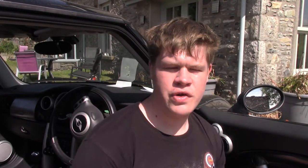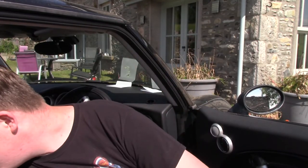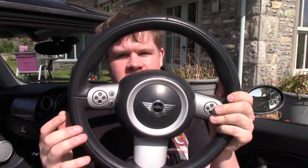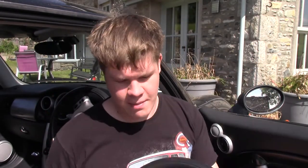At the moment we've got this horrible looking two-spoke steering wheel just behind me. It is the multi-function steering wheel, which means if you've got cruise control or heated seats you can adjust that on the steering wheel. So if you're doing the swap yourself, make sure you check that before you order your new steering wheel. I also have the new steering wheel we're going to be putting on, which is the much more preferable three-spoke Cooper S steering wheel, and as you can see it has the buttons on the front — it's also a multi-function one, so again check that before you order.